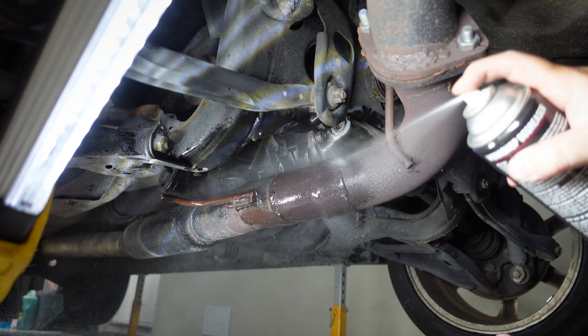For the second week in a row I'm jamming myself into an R34 footwell. The 15-amp fuse in the first row is the one we're looking for. With that removed, we start the car and it'll run like garbage for a short period while it consumes the remaining fuel. So that now has no fuel pressure — pretty safe to work on.